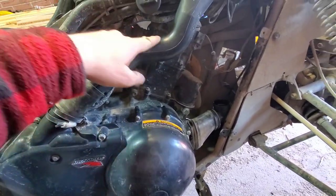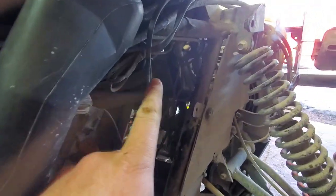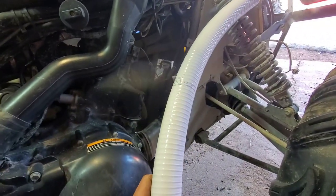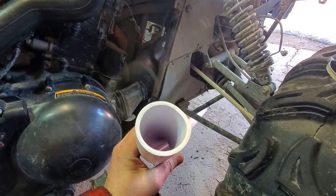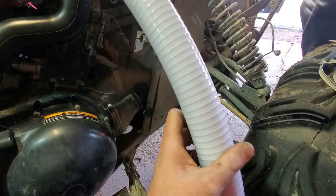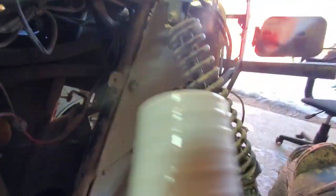So from here across, cut, run a line Y down to the bottom here. And we're going to find a way to run the piping up and underneath and around all these brake lines and electrical wiring. To do that, we're going to use this flex pipe that we got from our local swimming pool supply store. This is an inch and a half flex PVC, and if you heat this up with a heat gun or a hairdryer, you can easily shape it and bend it to whatever you want. So we're going to bend the pipe to go up in between there.